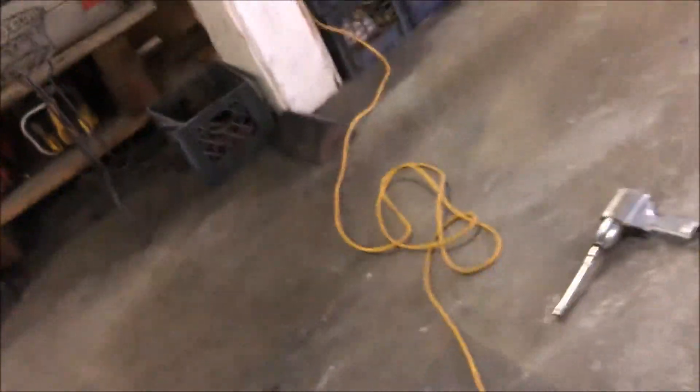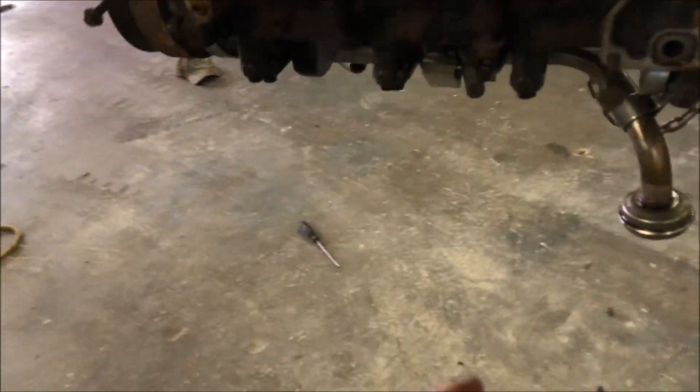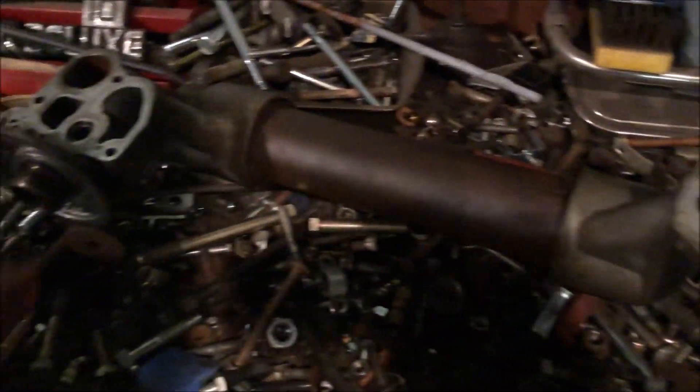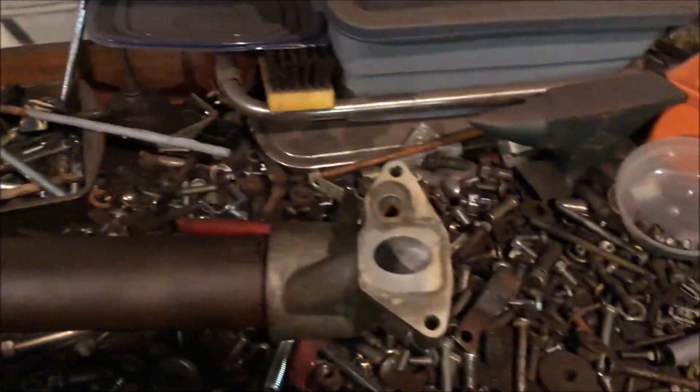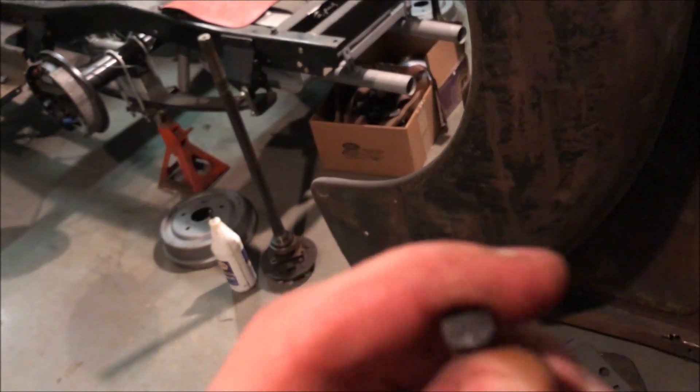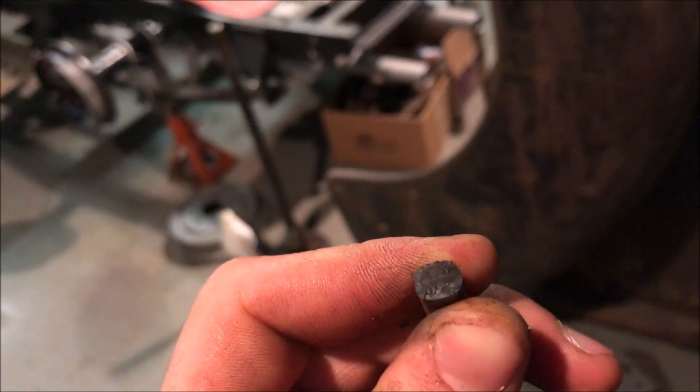I also have the oil cooler off. I took both ends off the oil cooler, cleaned it up a bit, and put some brand new seals in it because it's not worth risking it. You guys know what a pain this job is when the engine's in the truck. A lot of these seals tend to dry rot out — for example, this one you just snap in half, you can see how hard it is.